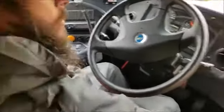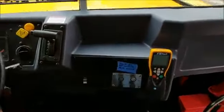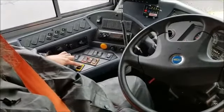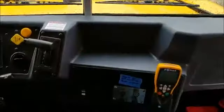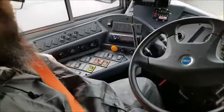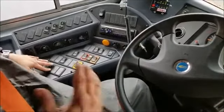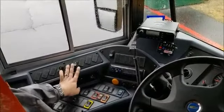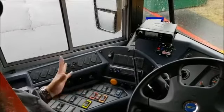Next I'm going to create a little bit of noise — I have the rear air conditioning going. I'm going to use the noise suppression switch, and it stopped all the noise in the bus, so I know that's working. Heated mirrors — not required to be checked. My driver fan: high, low, and off — it's working properly. And my rear heaters, both of them: high, low, and off — they're working properly.